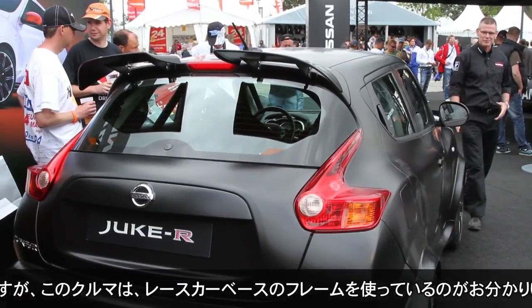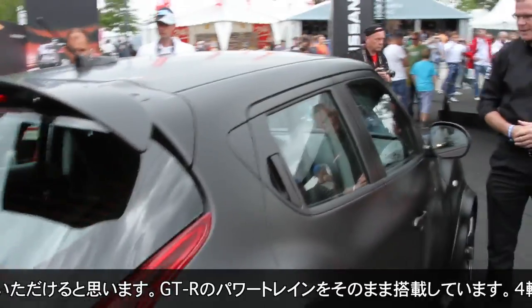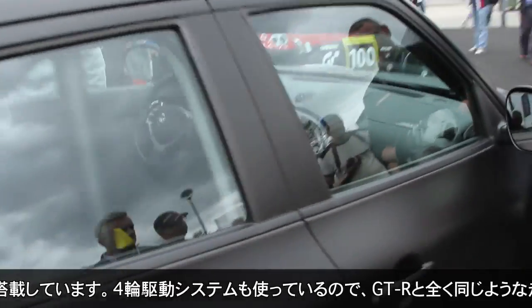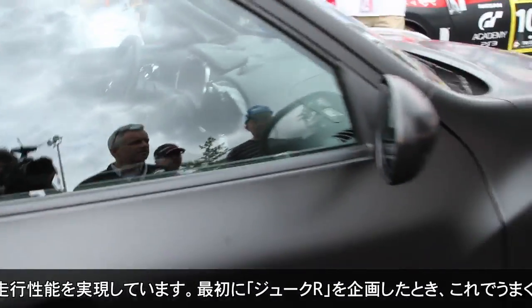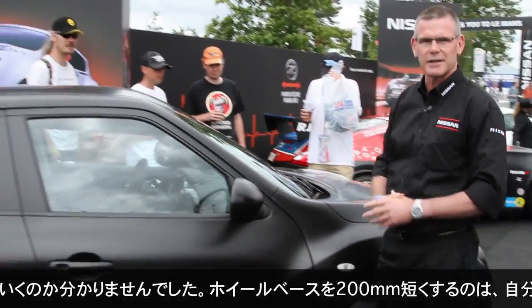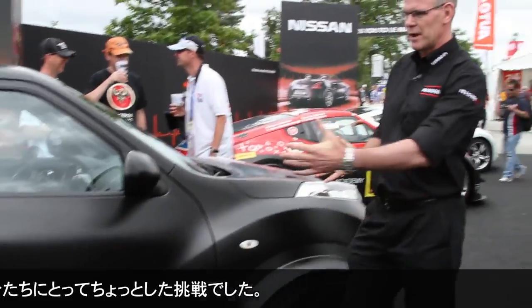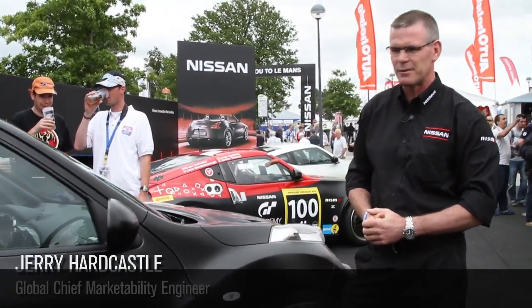Is it as simple as that? If you take a look inside, you'll find it's actually a racing space frame inside that we built, but we managed to keep all of the Juke GTR running gear. So the GTR engine is under here, we kept the four-wheel-drive system — it all works exactly as it did on the GTR, only we had to reduce the wheelbase by about 200mm.